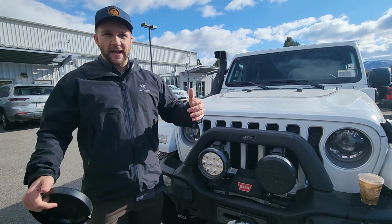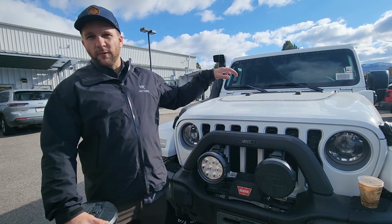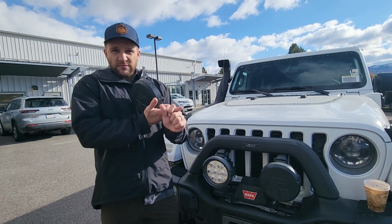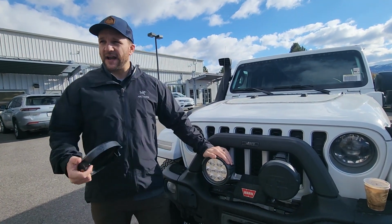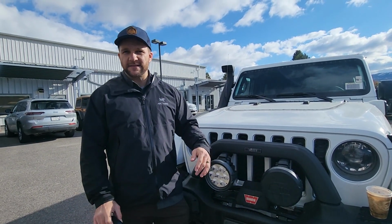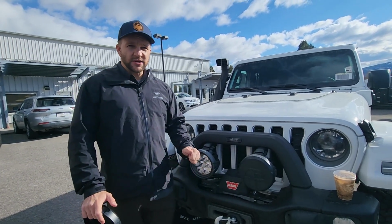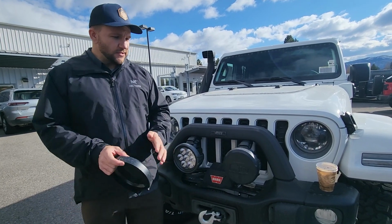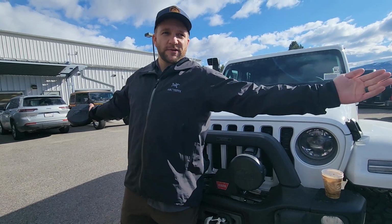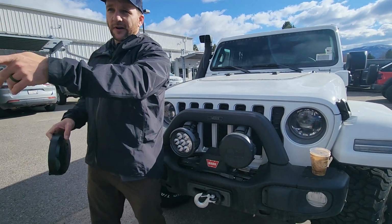They make lights for like Caterpillars, in huge, dusty, dirty places, way overkill for what you would need for off-roading, and we said, okay, we need the best waterproofing you can get. So they're IP69 waterproofing. It's 6,000 Kelvin, which is the color, so it's pure white light. It's not off yellow. It's not blue where you're going to get in trouble. It's a combination spot and flood light. That means you get a really wide pattern, but it's also really far. It's kind of like a Christmas tree, if you can picture, just really wide, like a big triangle. So it gives you wide visibility, but you can also see really far.